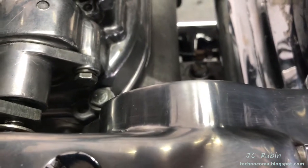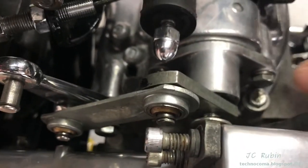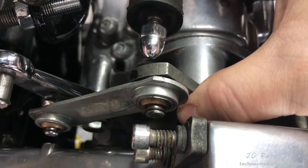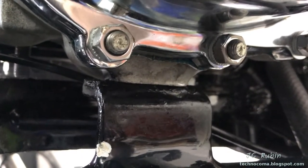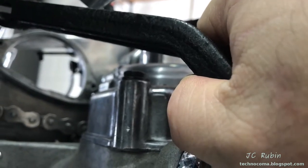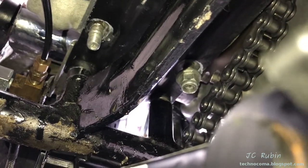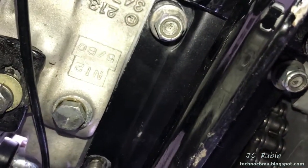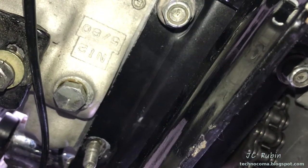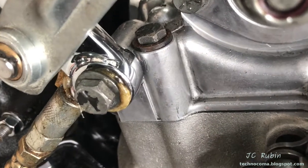The transmission was allowed to float. What I'm going for is the ability to deflect the transmission so it still has room to move. We can see it moving from both sides. It's very important that the inner primary lockdown doesn't impart any stress on the transmission or the frame, or something's going to crack. A view from the bottom - without the spacers these studs would bottom out against the mount and stop the transmission from pushing all the way back, which would stop the primary and cause a gap on the engine. The shift linkage was also greased and tightened down while there's room to do so.